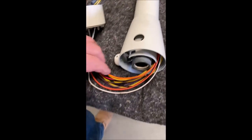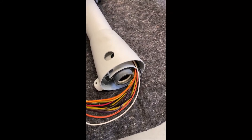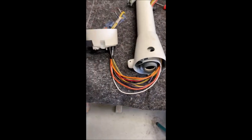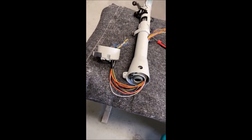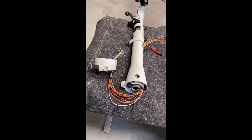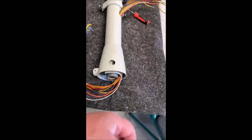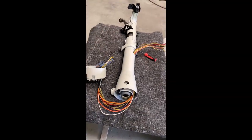The last one's always the hardest. I'll pull them through and then put the hub on. Sorry for the jiggly camera work. That's how I put the turn signal wires through. If the steering column is in the car you can do it that way too. There are other ways — you can tape them to a wire, feed the wire through, and tape each one individually to pull it through. But this is off the car so it was easy.